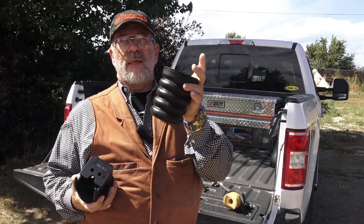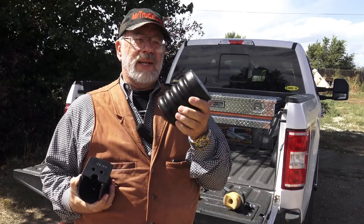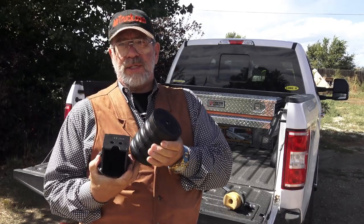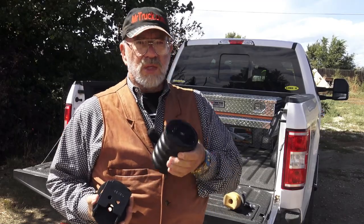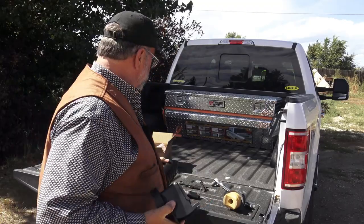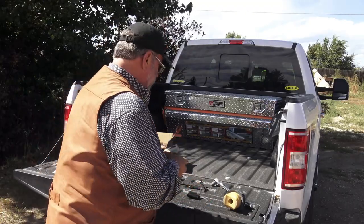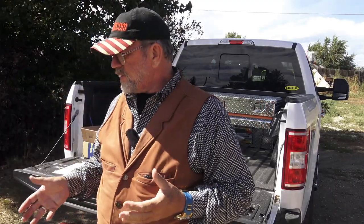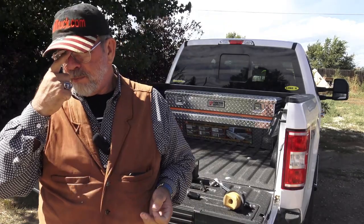So that absorbs the shock. And this can compress 80%, and depending on the application, it can actually expand 50%. So it actually will ride with your axle and cushion the reaction, because that's what we did with Super Springs. It controls how fast or how much your axle and your springs move. So it's like a big anti-sway bar that knows what it's doing.